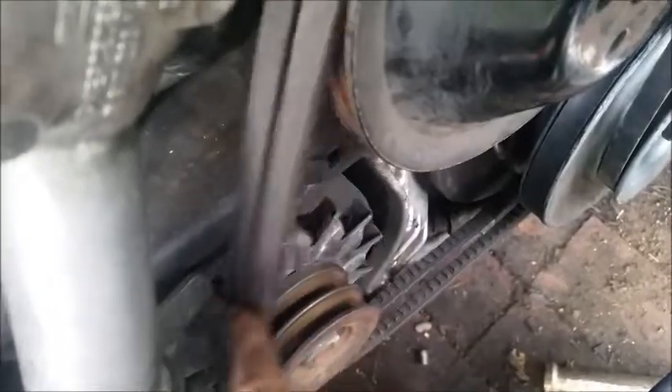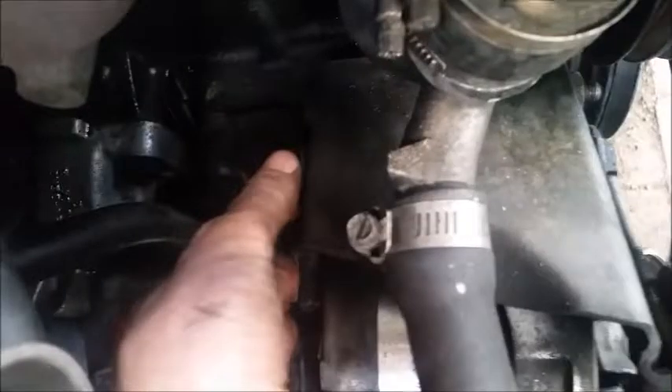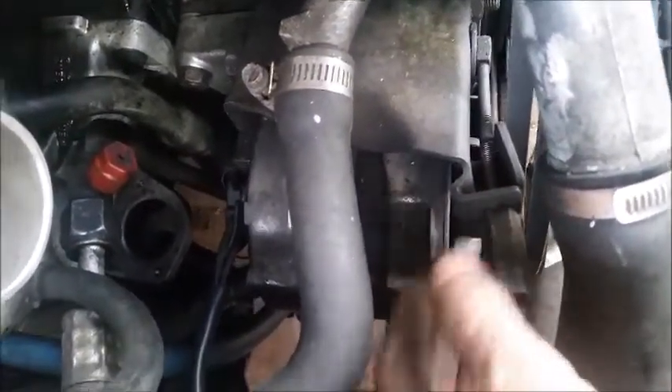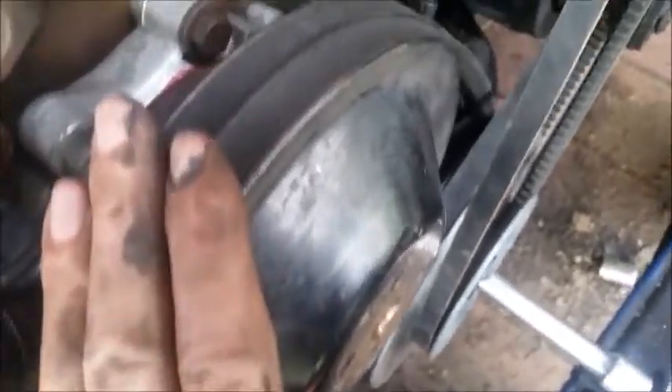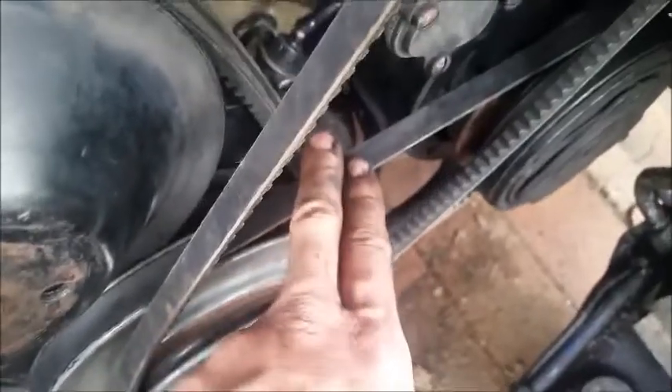On this car it is the two that go to the alternator. As you can see it's not tightened up. You loosen the one at the back, which lets you turn this one to lift it up or push it down. It is currently in the down position where it's nice and loose to get the belts on. This isn't bolted in place — it's just sitting there so I've got the belts in place to do the AC compressor and power steering pump one.